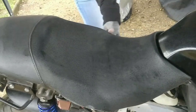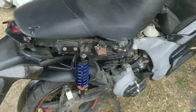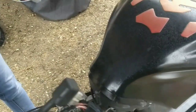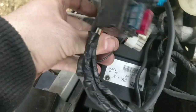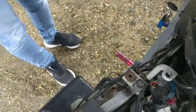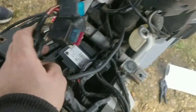See the hanging loose wire you were talking about? I've been told it was for a standard alarm. I don't think that's right — I don't think these came with standard alarms. This is probably the latest model it could have. So this is the pin we've all been wondering about. That could definitely be an alarm because it's got everything. Some of the connectors I was considering was the regulator down here — that's fine, that's normal. I still think this is an old CDI. It would have gone in like that down there and this CDI is the replacement, but this bike at some point ran. So we'll get that nipped up — that's not going to help. We need a good connection. We need to know we've got spark.